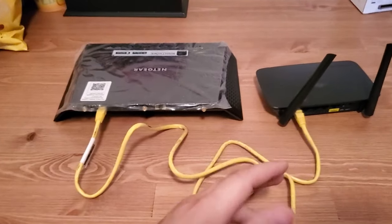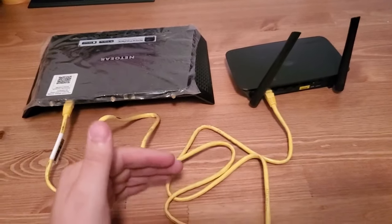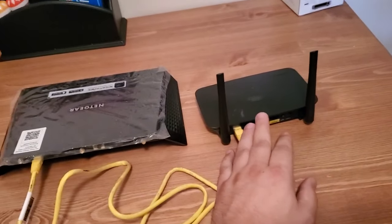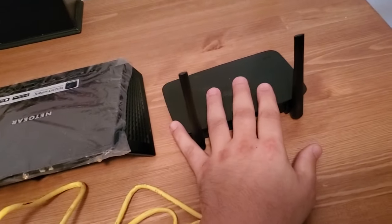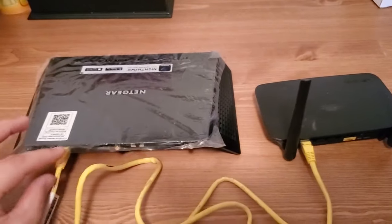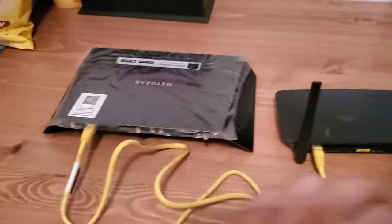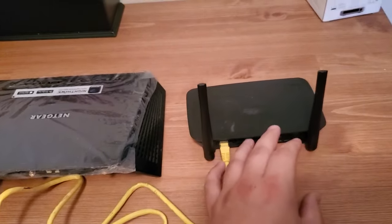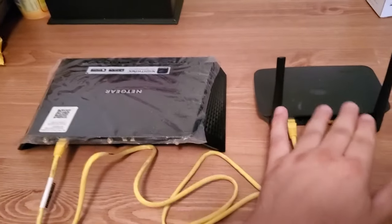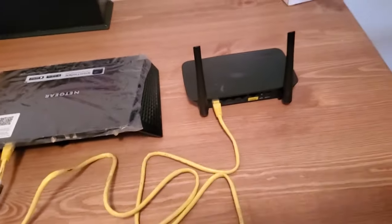You might get away with it for a while, but eventually — for example when it's time to renew your IP lease — problems can appear. Say you go to work and disconnect from the router, then come back and reconnect. It's going to assign you a new IP address. If your computer is plugged into a wired port and has held the same IP address, this router could randomly assign your phone that same IP address your computer already has. That's when you run into IP address conflicts.